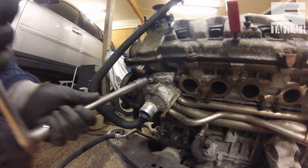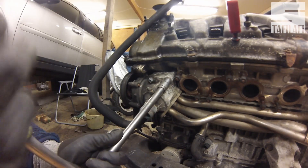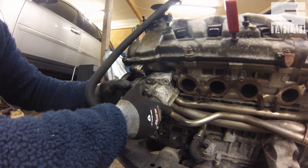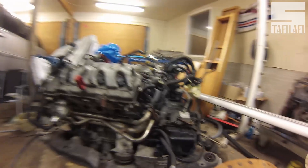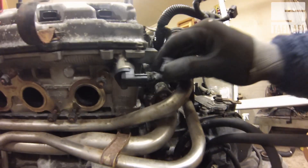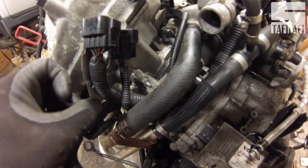Here I'm releasing the two screws that hold the water pump to the cylinder head. There's a bracket over here that needs to be released — there's two nuts holding it. Then remove the connector to the camshaft sensor. Remove one side of the connector from the bracket, then the bracket is loose enough to just move to the side.